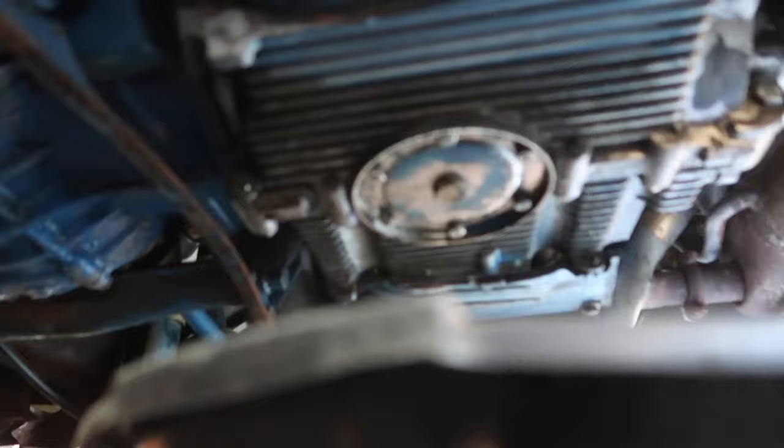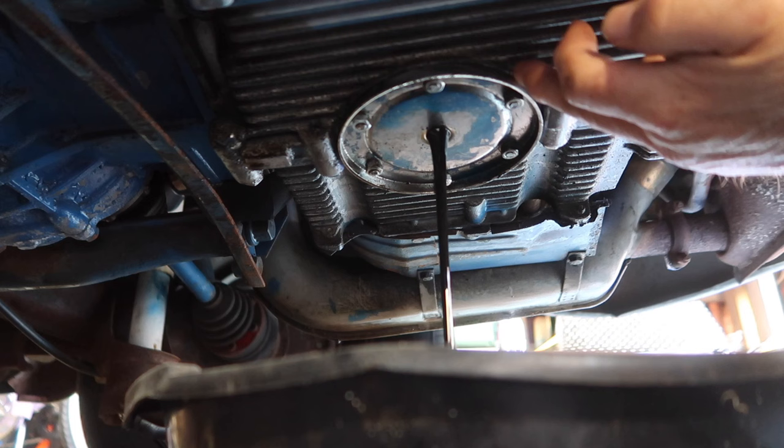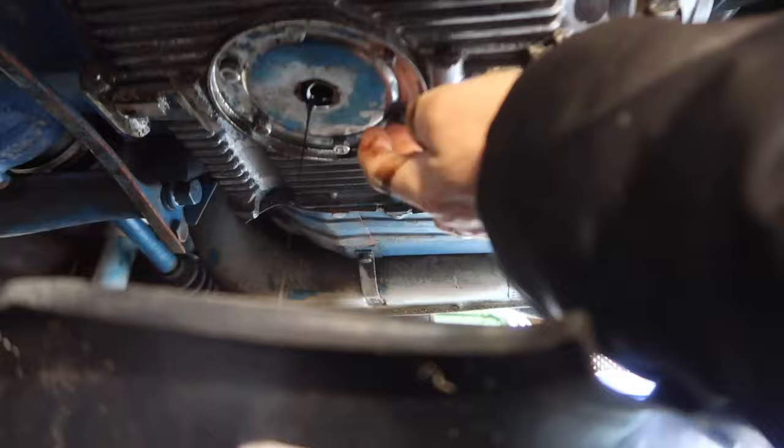I'll get a pan and let the oil out. Even though I don't have to, I'm gonna take this ring off this whole piece because I do have new gaskets and copper washers, just in case it's leaking from around this as well. I'll change the whole thing, and I can also check the screen up inside here. The oil looks very dirty, actually.